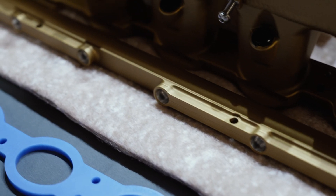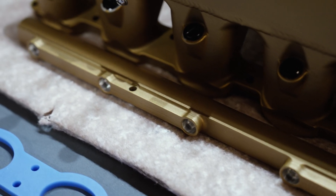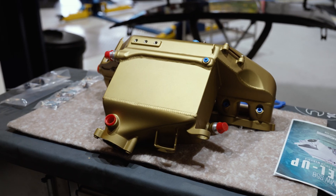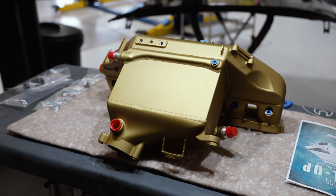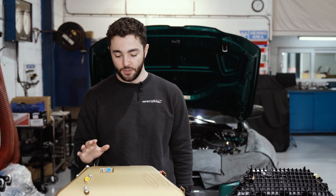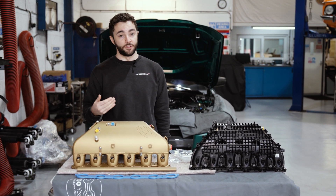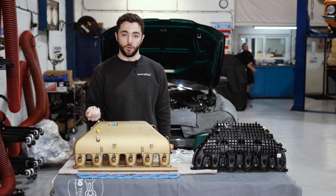Other features include a fuel rail for the indirect injection, with ports all the way along the front. On the back, you've got ports for water methanol and also nitrous, whichever you want to run — this is for guys really pushing the limits with bigger turbo conversions in very hot climates. There's also a pad on the back with multiple vacuum ports, which is very handy when setting up water-meth and other triggers dependent on vacuum.